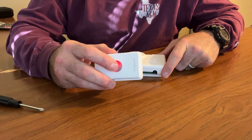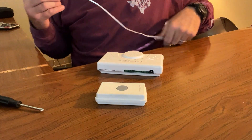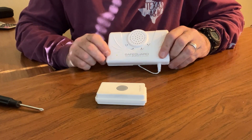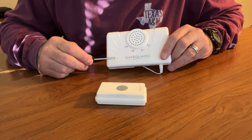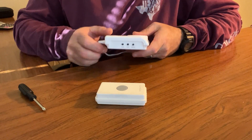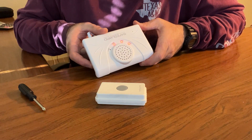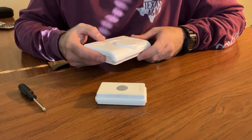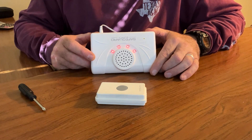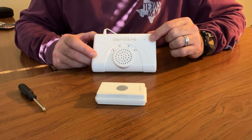Now that the battery is installed on the UTX, make sure the ERA DCRX is powered up. Insert the plug-in adapter included with the kit. When you plug it in, a small green LED lights up on the bottom. If you're not seeing that green LED, turn the unit to the side and cycle through the volume button. If it's on mute, press the button again until the highest volume level is set and that green LED is illuminated.